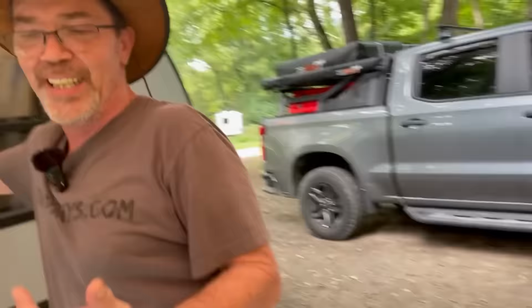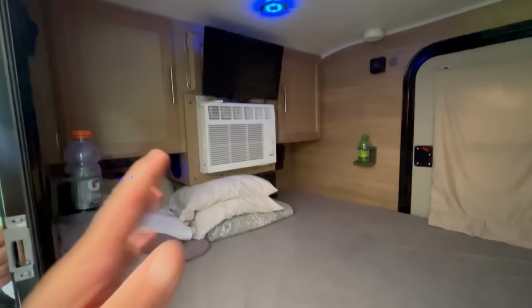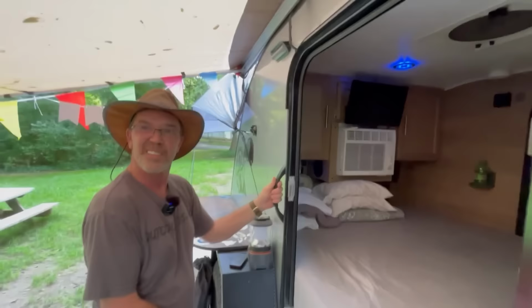For the air conditioner with the heat problem, everybody tore it out and put fans inside. I have a radiator fan underneath, in the bottom to suck the air down. So now that's going to be waterproof. That's waterproof, so that's a big score. Now what we're talking about here is that these FB models, and this is cold, there's cold air blowing out of this trailer right now, so I know it's working, but these had issues venting the heat out of it. So the AC would shut down. So he's cut vents in the side. And what he was describing is you powered an additional radiator fan, like a 6 to 8 inch radiator fan, to blow the heat out.